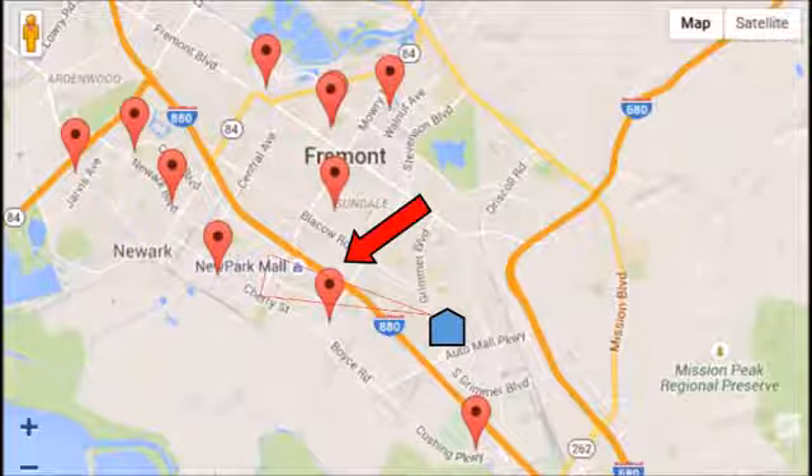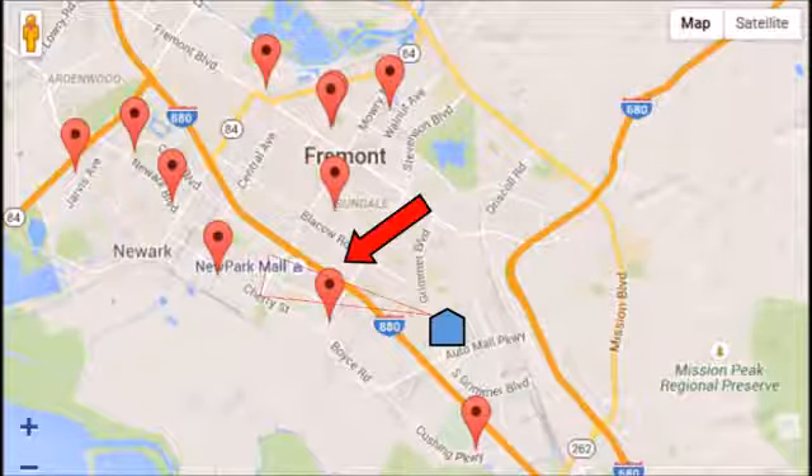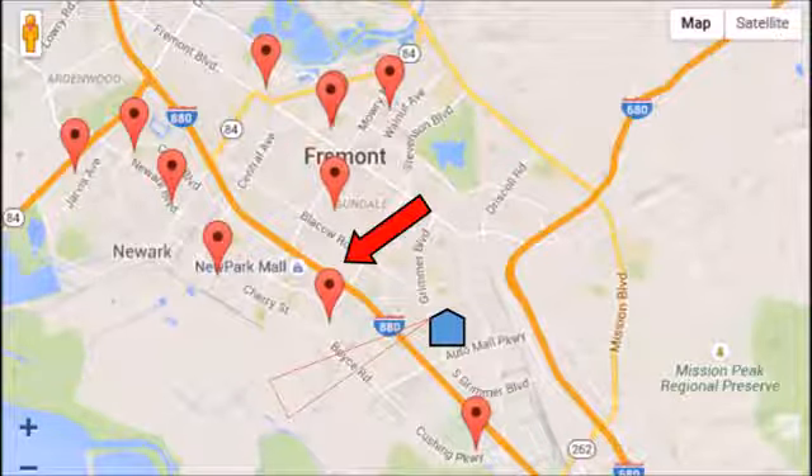There are some ways to get around this. The first thing you might try if you are getting the red flashing lights on your booster is to change the direction of the Yagi antenna. By pointing the directional antenna away from the cell phone tower, it's quite possible that you will reduce the amount of signal coming into the booster and get rid of the red flashing lights.